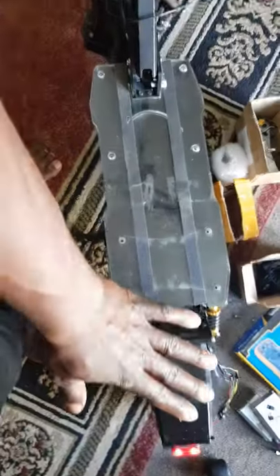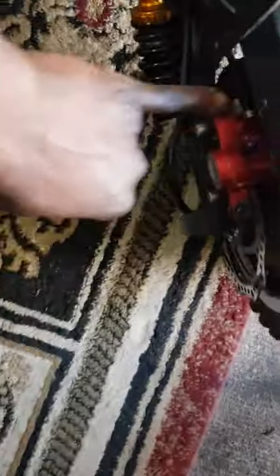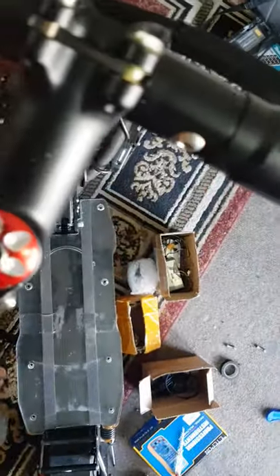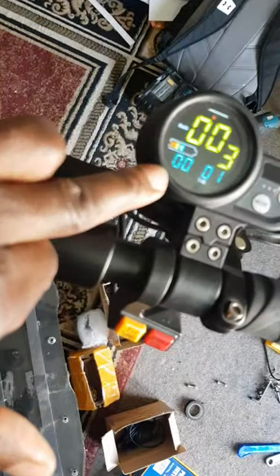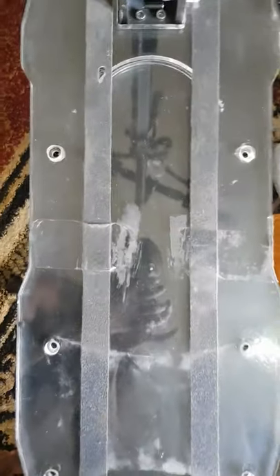When you're riding your scooter and it just stops — maybe the front or back motor is working but then both motors stop — and it's showing that brake sign, that means your brake sensor might be at fault. You've got to check to see if your brakes are loose. Do this a few times and check if nothing is stuck within the brake. Check your brake calipers as well to be sure nothing is stuck. If you did all that and it stays like that, you've got a problem, and there are three suspects.